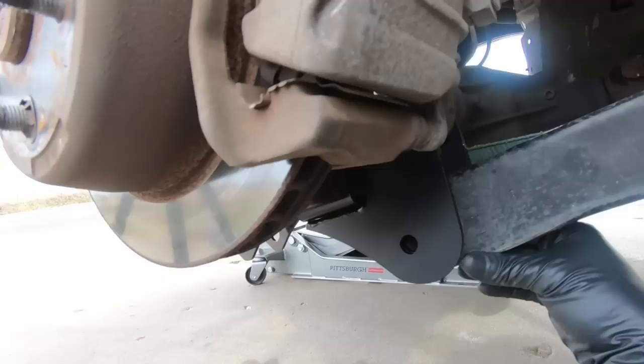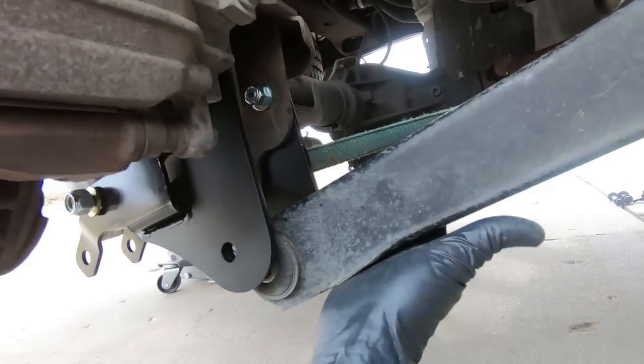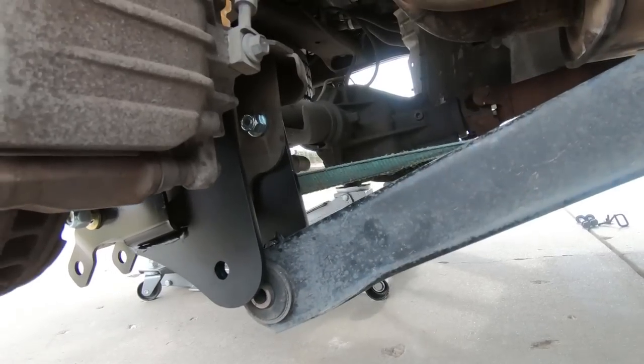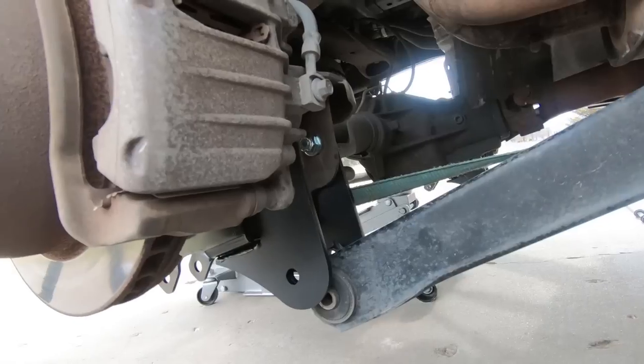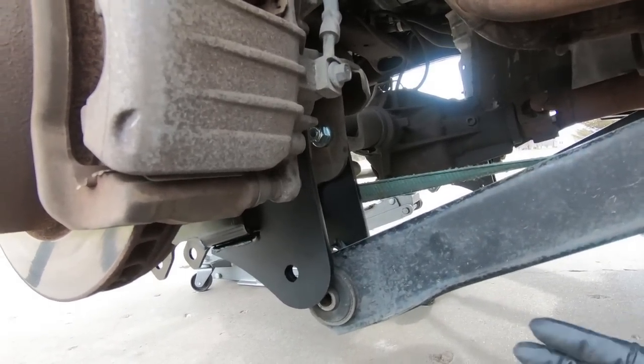I've been able to loosen one side at a time, but we're gonna go ahead and get these bolts in here. I'm not gonna tighten any of the suspension, the parts that move up, until we have the thing on the ground and a load on the suspension. But for now, I do wanna go ahead and get those bolts in, and so that's our next step.